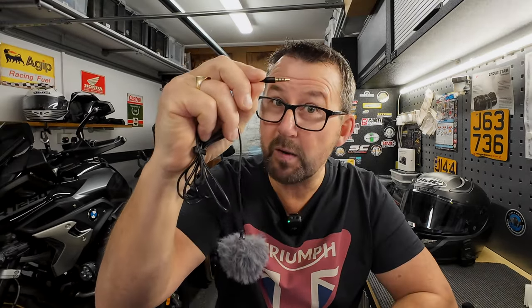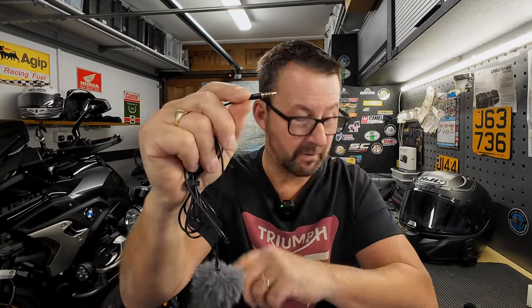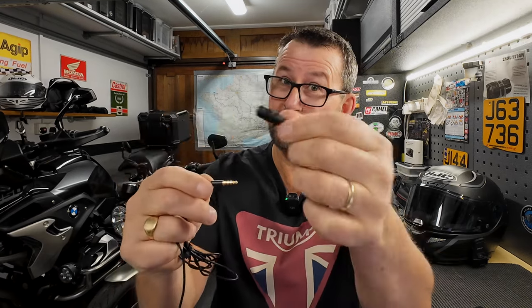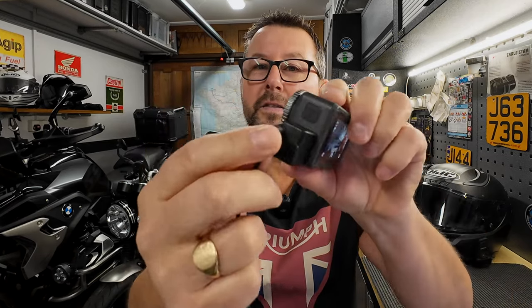So how do we connect the Purple Panda microphone into the adapter? The Purple Panda has a TRRS plug — that's three black rings. However, the adapter requires a plug with two black rings, which is a TRS plug. You might be able to get a lavalier mic with a TRS plug already, but the Purple Panda hasn't. Fortunately, the Purple Panda kit supplies you with an adapter plug. We pop that in, make sure it clicks, then simply plug the TRS plug into the adapter hole — and that is ready to go.